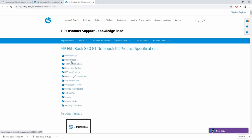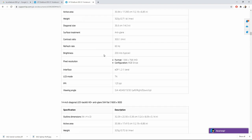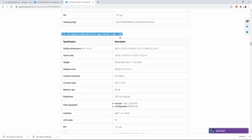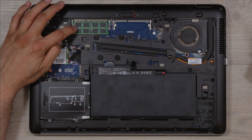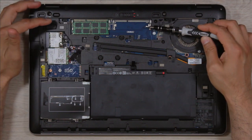Step 1c: look for easily available documentation about upgrades, repairs, or general maintenance from the manufacturer or a manual. Many modern devices are not designed to be serviceable, so you want one with official support or guides for RAM, disc, screen, and trackpad upgrades. For example, knowing the maximum RAM the laptop takes helps you decide — if one DIMM slot is occupied, you can just add another stick to max out the RAM.